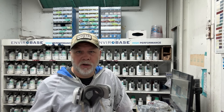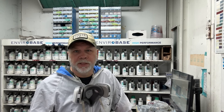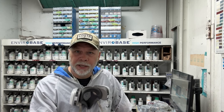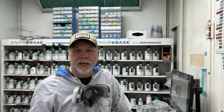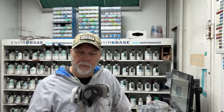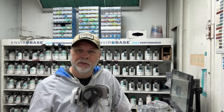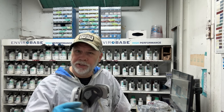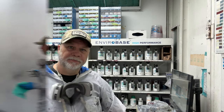Almost every week we had a car or two come back with rock chips in a new panel. They would put a new hood on the car, wouldn't get sealed, but it'd get painted and cleared, and then it would have rock chips. So it chipped fairly easily. And the common theme among all these panels that we redid was no sealer. So remember, sealer adds adhesion, strength, durability to the overall paint job. It's a good idea.